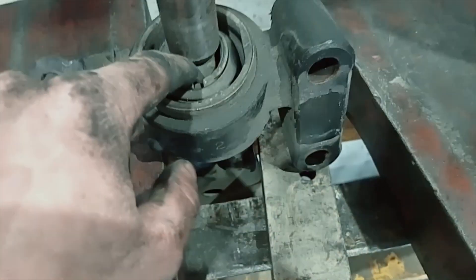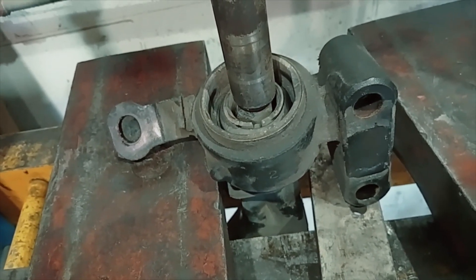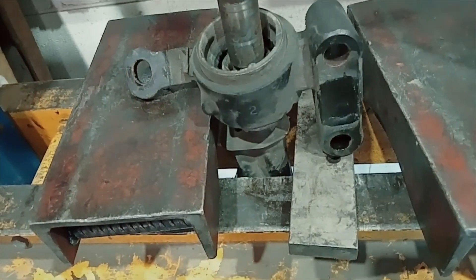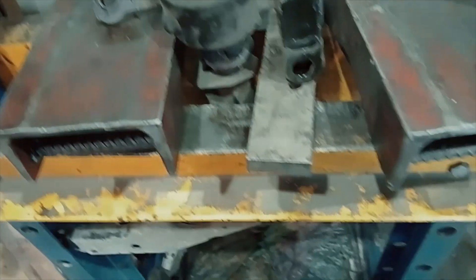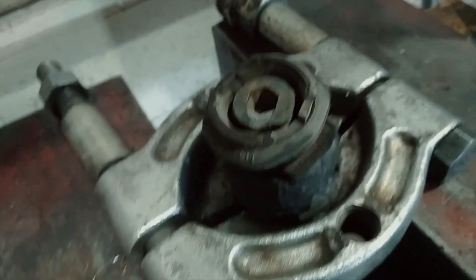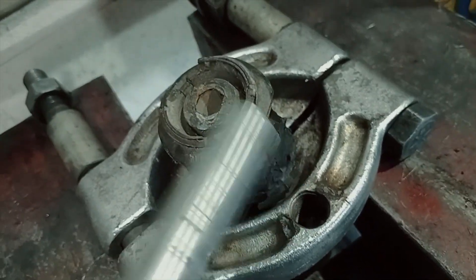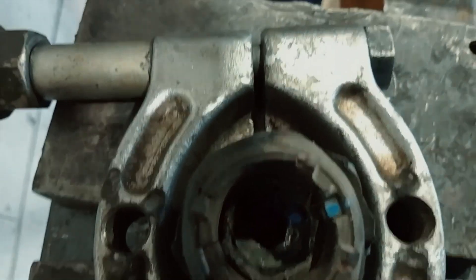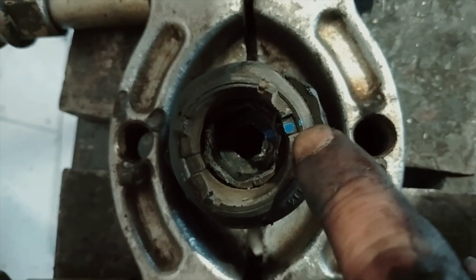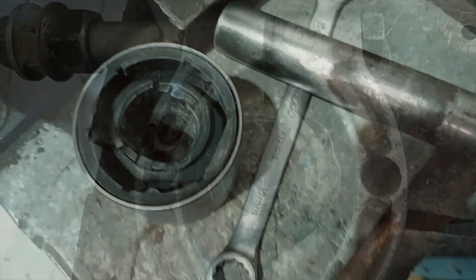This is in the way for pressing, so we're basically going to try and rip that outer housing off by pressing the center with the outer housing held. Here's how I set up for this one — I'm just going to press down a little, and if it doesn't come out with the press you may have to cut it with an angle grinder to release it off the shaft. You also want to mark the orientation of this before you press it right out, so we can line it up against the old bush.